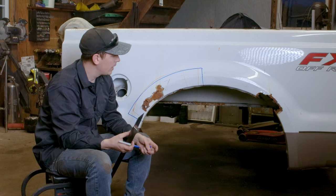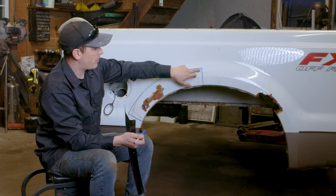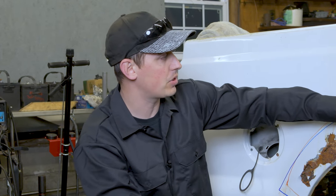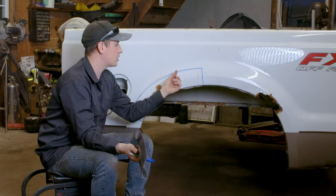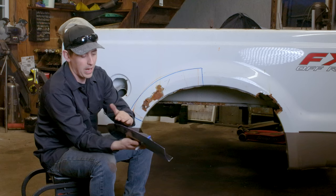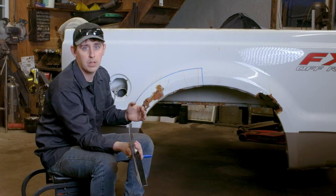Once you have your cut line marked, follow it with nice straight lines. There's a little controversy here: some people like to go in a little from the line and overlap the panels, but to me, unless you have a step tool — and even sometimes step tools don't work too great — it just makes a lot more body work because it bumps out the panel, requiring more welding, more grinding, and more finish work. Also, if you step it and don't seal the back side really well, moisture gets in behind the step and it won't be long before it rots out again. In my opinion, butt welding it, going nice and slow with a really good fit-up, is your best chance of success.